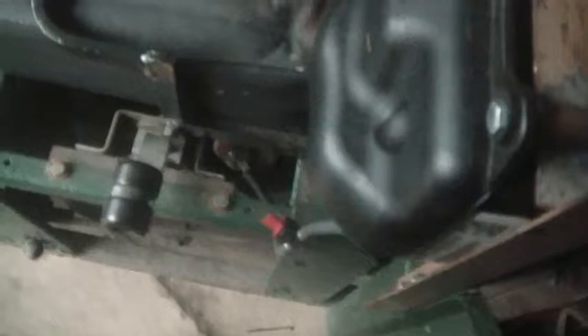I'm going to try to fire up the Cushman. The last video I made was Tuesday maybe, about firing up the Cushman. I've had the battery charger on it, turned down to low — two amps — for a few days in hopes of it taking a charge and firing up. Just before I came up to the garage I turned the gas on for about 30 seconds, hoping to get it to start. Let's give it a little gas here. I ended up putting this gas tank on it and getting rid of the fuel pump.